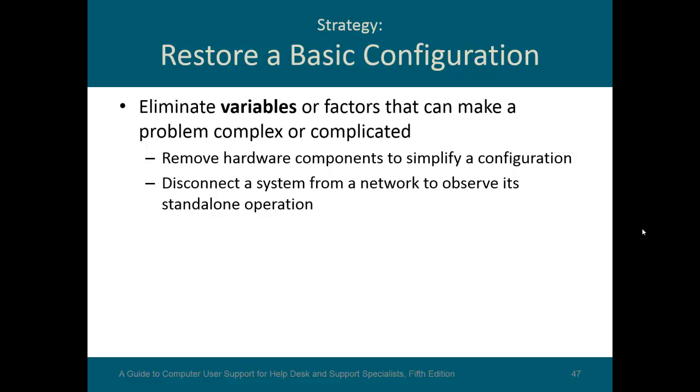All right, let's turn on a WEP key. Let me turn on a WEP key on the computer. Okay, can I connect now? Yes. All right, let me do WPA. Okay, does that work? All right, now let me try WPA2. So I'll slowly go through those steps, but I'll restore things to a basic configuration first. That way, I can eliminate all the advanced stuff.